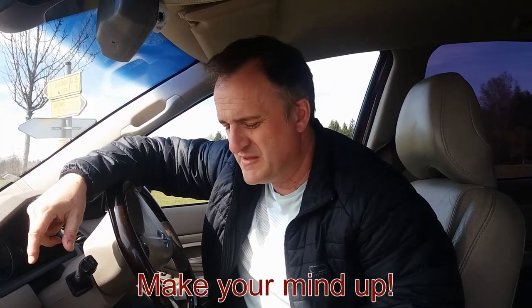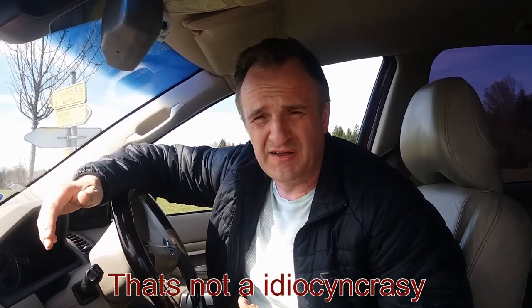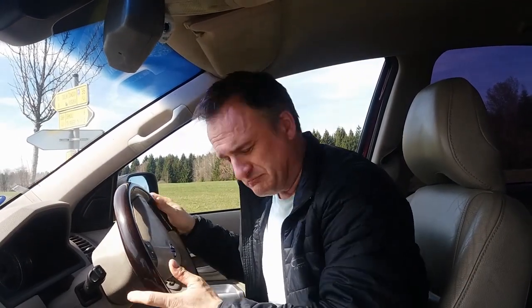Many problems on this car is because I've had it for 2 years and I've kind of maintained it, but I've also kind of neglected it at the same time. I've got used to some of the foibles, some of the little idiosyncrasies, and one of them is the fact that it's actually completely and utterly dangerous to drive. I used to have to slow down to go around corners because when you put your foot on the brake, it was so wobbly on the steering, and it's all down to the fact that the bottom arms needed replacing. And I'd actually done a set of arms on this 2 years ago, just after I'd had it, and they were cheap Chinese ones, and they wear out very, very quickly. Now I've done it again with cheap Chinese ones because I'm not aiming to keep the car that long.